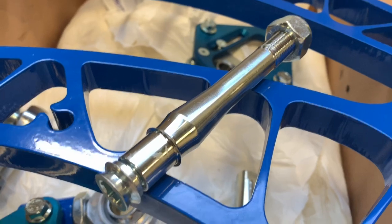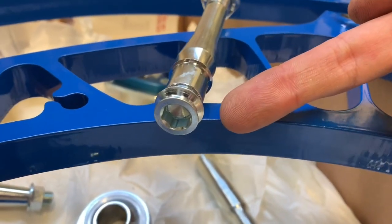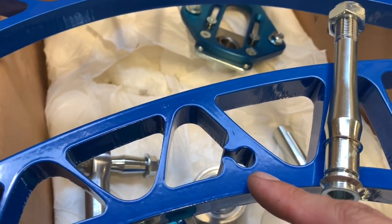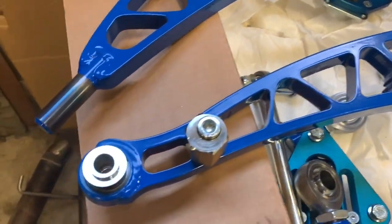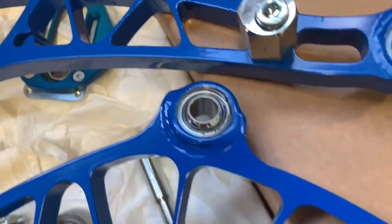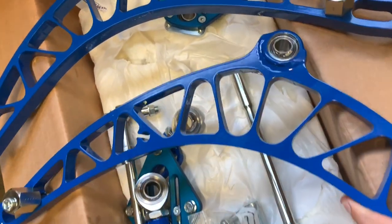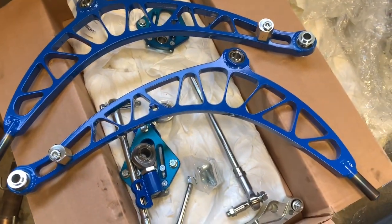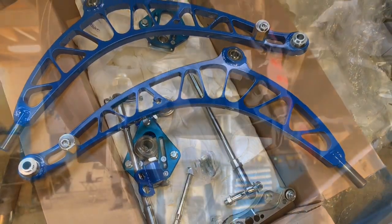That's the pin outside of the car — this is a hex 10 as you can see over here. This has a provision for an anti-roll bar link. This is the lock stop, which is adjustable. The newer version arms have an offset, giving you a little more droop so the arm can physically go lower if you would detach it from the shock — all very nice.